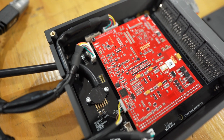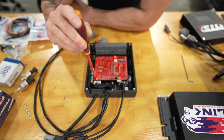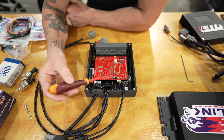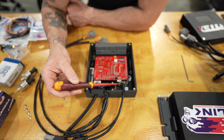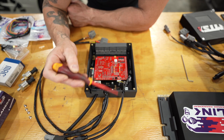On the board itself it will tell you what each harness is allocated to on the ECU - whether it be an analog volt, a digital input, an auxiliary, or whatever it might be. Then this cable here is your tuning cable, so you can upload tuning files and all that type of stuff. And then there are two CAN networks which come through here.